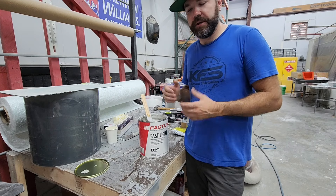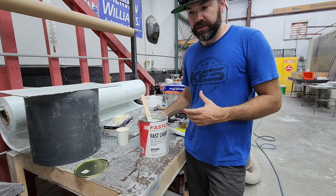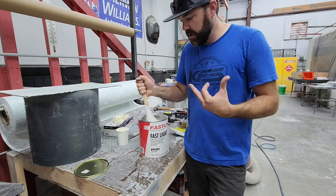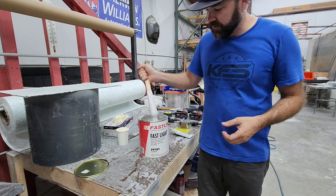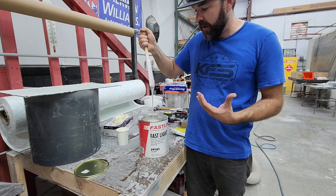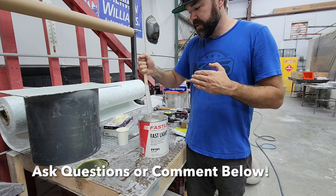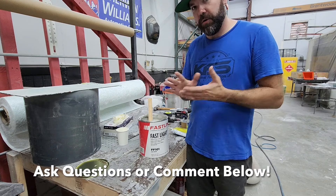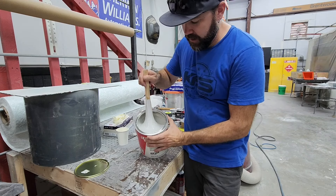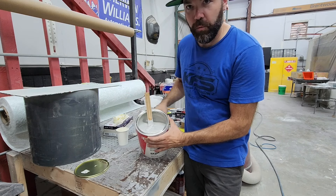What we like to do is add about 10 ounces of liquid polyester resin — just dump it right in — and then stir for two or three minutes until it has a real nice cake batter consistency. The nice part is that on your final coats, it's almost like a glazing putty that will self-level. You can actually see it self-level right in the container, which gives you a good idea of how and why it works better thinned out.